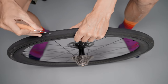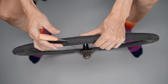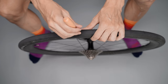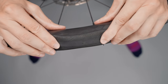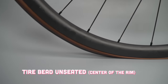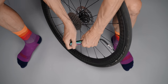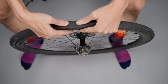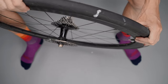Here is the main point of this video: the tire needs to stay seated even when deflated. Not only because it's easier to just add sealant and pump it up and be on your way, but the main reason is if you ever get a puncture out on the road, I really want the tire to not pop off the bead. I'll illustrate this by puncturing my old tire. Notice my tire is still seated after fully deflating — this might help protect the rim if I'm trying to bring the bike to a stop. When I plug this kind of puncture, I'll be able to pump the tire back up with my tiny hand pump. Had the tire unseated, there's no way I could pump it back up with a mini pump.